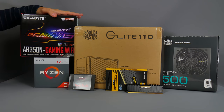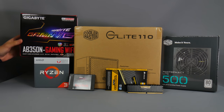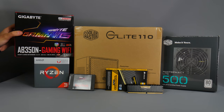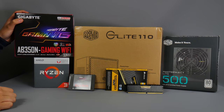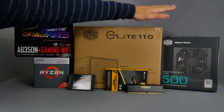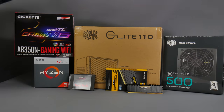For motherboards, it's a mini-ITX case so we need a mini-ITX motherboard. There aren't too many available for AMD's Ryzen AM4 platform. You don't want to go for the X470 or X370 chipset because they're expensive, so I've gone for the Gigabyte AB350N Gaming Wi-Fi at around $100. It's the cheapest one that fits in our case. I'll link below to my Forbes article where I build a micro ATX PC with similar overall pricing.